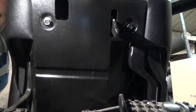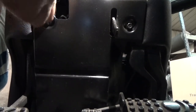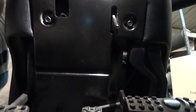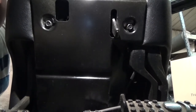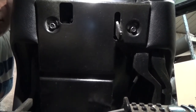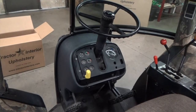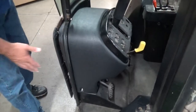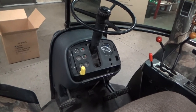You'll hear a little squeaking and that's just the plastic sliding around. You want it to be nice and tight, because if you don't have a good tight fit you'll end up with squeak and rattle — that's just from a poor-fitting part. If you get these things lined up properly and get it in there, it'll be a nice tight fit with no rattle: quiet, easy installation. It's a little tight on the two side holes, but once you get them drawn down with a little pressure, everything lines up pretty well. This should make quite a difference in sound suppression in your cab, because a lot of noise comes from under the cowl and between the headliner and the roof, so make sure your foam is in good condition in those two spots.